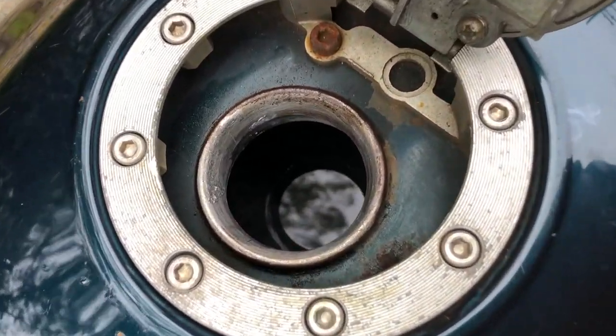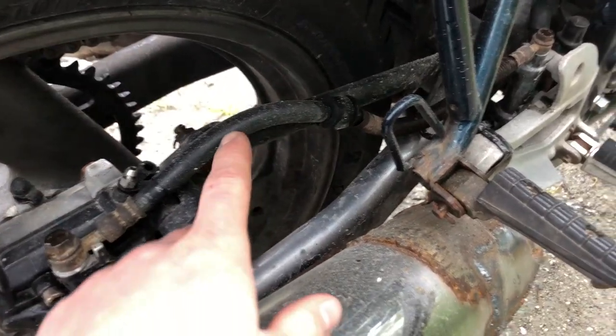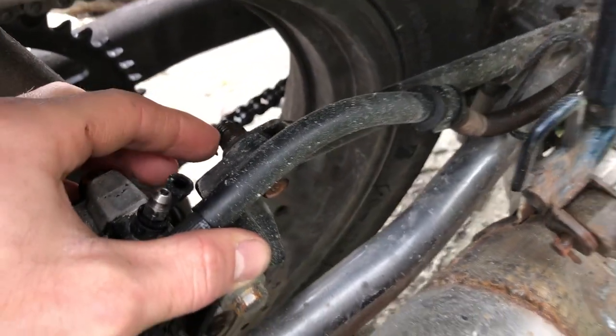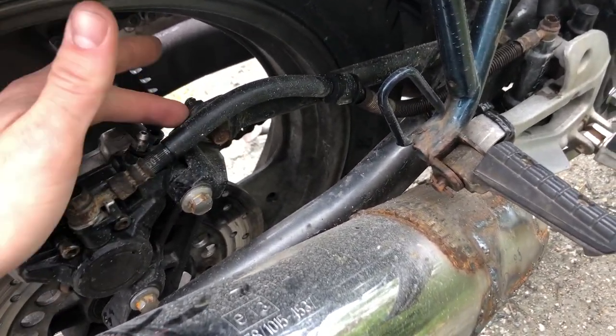The XJ being a very old bike, you want to inspect the gas tank for rust. Look in there for any suspicious rust because sealing a tank can be a nightmare of a job. Yamaha also implemented an arm here to hold the upper end of the bracket for the rear brake. Make sure all the cotter pins are in place for these nuts and bolts, or else you wouldn't want one of those to rattle loose and have the arm come flying off. Check for the cotter pins.